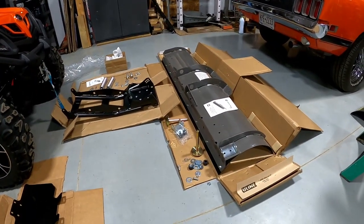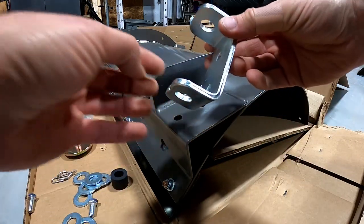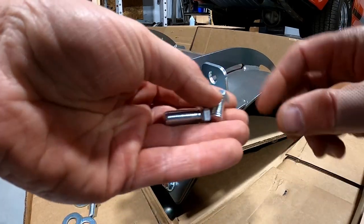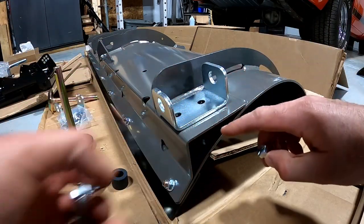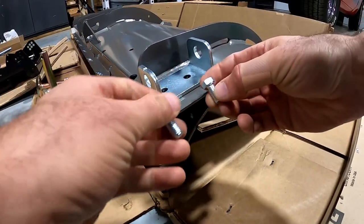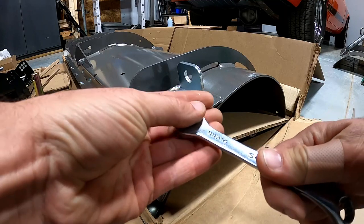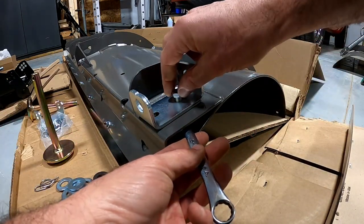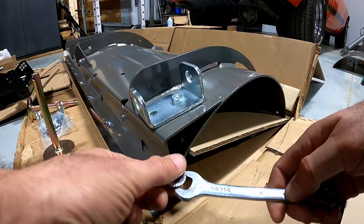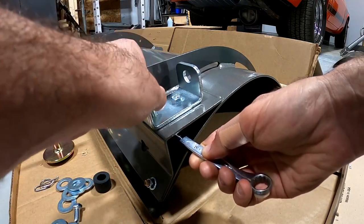The first thing we'll do is show you how to put the plow shoes on. For the plow shoes, you want the notch on the mount to be at the bottom of the plow — it's going to sit just like this. You're going to see two different lengths of bolts in the KFI kit. I always use the shorter bolt on the top because of how this is tapered, and the longer bolt in the back. You want to bring the bolts in from the top. I use an open-end wrench, sneak the nut on there, and slide it in and tighten it down. That way I'm not trying to reach in there — I let the wrench do the job for me.